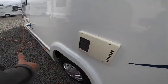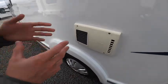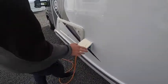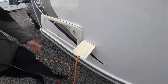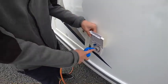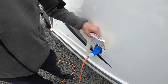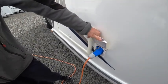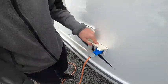You've got your vent for your diesel heater - this is a Truma diesel heater and this lets the vents in and out. The mains hook-up point is how you hook the vehicle up if charging at home or on a site. Get your hook-up lead, lift the collar, hook the van up first then walk to the other end and hook up to the point. Do it in reverse order when unhooking, pushing the blue clip down and releasing the cable.